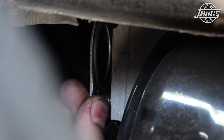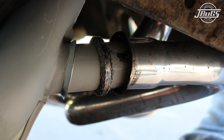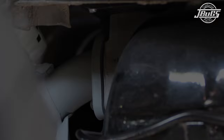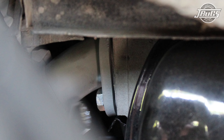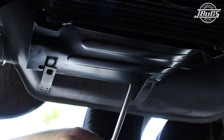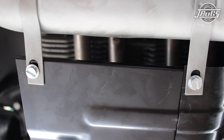With the tins in place, install new gaskets over the head studs and then slide new clamp rings and exhaust seals on the heater box. The heater boxes can now be set in place. Slide either box into the header first and then over the exhaust studs. With the box in place at the head and in the header at either side, thread the exhaust port nuts in place and tighten them up. There are two tabs that stick off of each heater box that attach to the heater channels with shroud screws. We had to bend the tabs on the left heater box slightly to line up with the tin before tightening the screws. On the right side, unscrew the outer screw that holds the tin pieces together and bolt the tabs to the tin, then tighten all the screws on the tin.